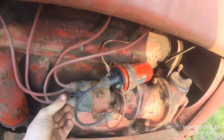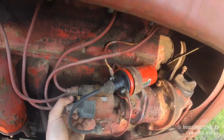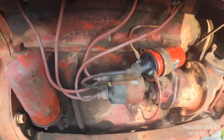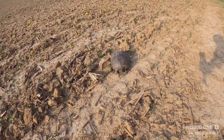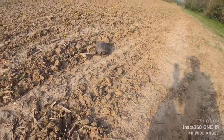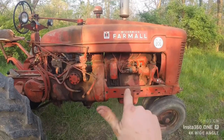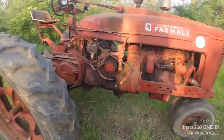Put it back together — dust cover goes in, there's a little felt washer, stick the rotor on until it finds its spot, then the cap goes on the same way: hold it up, rotate it a little to find the notch, hook both clips on, and the coil wire goes back up. That covers ignition. We had a visitor — a painted turtle, a pretty good size one. Anyway, we have fuel, we have spark, and the motor turns over — I think we're ready to try to start it.